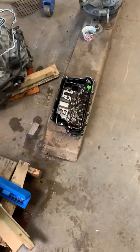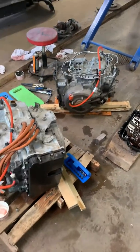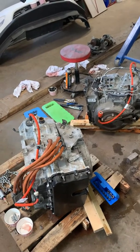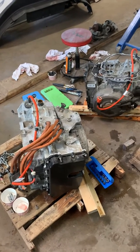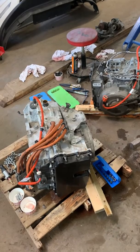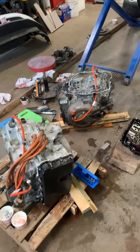The TCM is what we see here in the pan. So I bought a new one, but first tried a few other things — I checked the valve body, removed all the valves one by one, checked them one by one, made sure nothing was looking weird, no scratches, nothing. Everything looked new. So I decided to change the TCM like GM suggested.